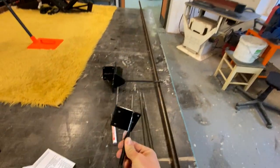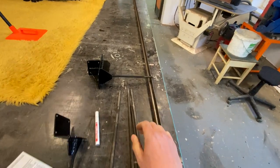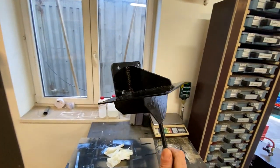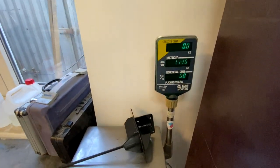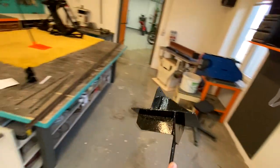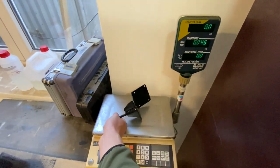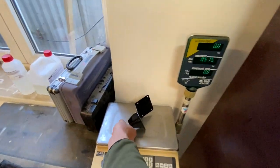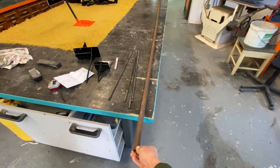This is essentially the whole structural part of the car together with the support connecting them together through the glued wood. I thought this would turn out hopefully a little bit more elegant, but hey, it at least does the job. And just in case you wonder, 1.1 kilos. I saw some of the frame structural parts people do on their mounting systems, and some of them are definitely heavier than this. That's essentially 3.2 kilos for the mounting system, excluding the support, which will be a meter long.